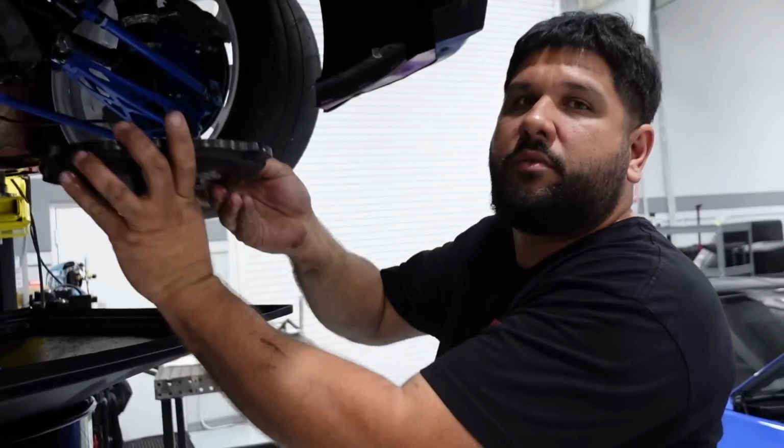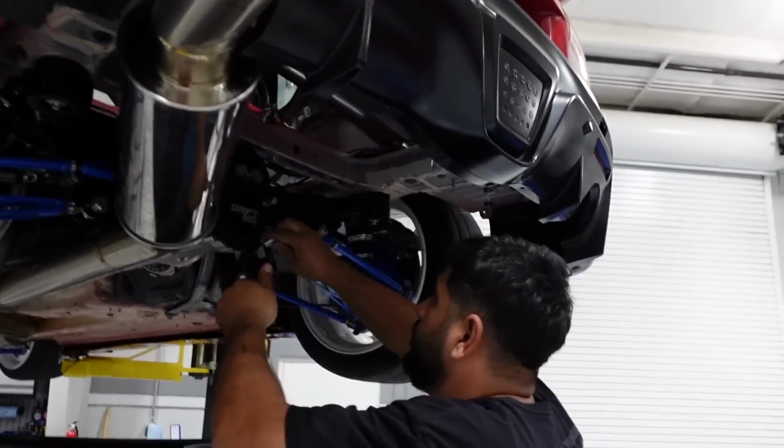to a 5.4. So before we had almost 70 or 80 miles an hour in first gear. So this thing was kind of long and made the splits a little far. So doing this will make first gear a little bit shorter so we can get into second gear. It'll bring the splits closer together. So this thing will sound a little bit more like an F1 car, and will give me a bit more ratios to play with driving around the compound.